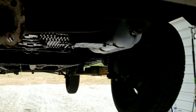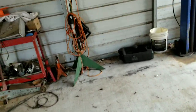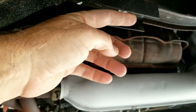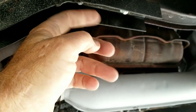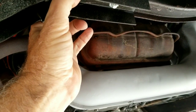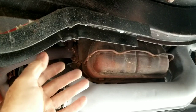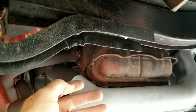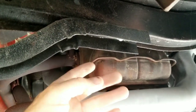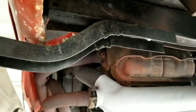We've been discussing this for a few hours and came up with this idea. We were thinking about making an L bracket right here underneath these mount bolts for the bumper. This is pretty sturdy frame-like material - it would hold a lightweight trailer. I would hope you're not going to pull anything heavy with your VW bus; they just don't have enough cooling system, engine, or frame underneath for something like a heavy type 3 hitch. So we're going with a type 1 hitch, which is the smaller hitch.